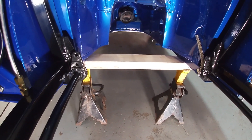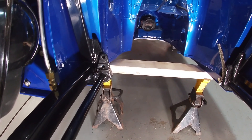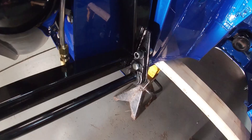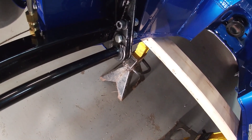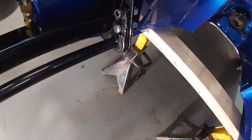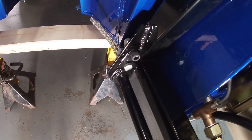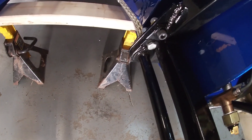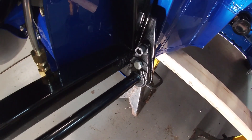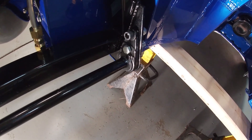I'm going to use this gauge dimension as the nominal, and then if I need to adjust it I'm hoping I can do that on the torque reaction plate. On the passenger side you can see I have the bolts in place for the torsion arm relative to the torsion bar. The driver side was actually correct — my marks line up on this side — but they absolutely do not line up on the other side. The other side was off by just one tooth.